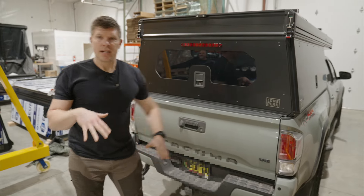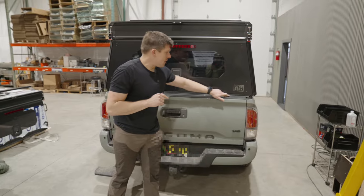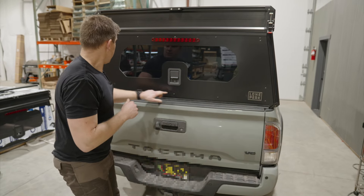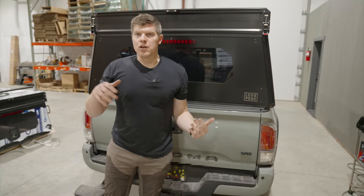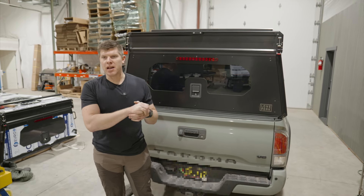Closing up — I like to get this bungee as high as possible. I'm going to grab my strap and use my body weight to pull it down. And then we do something called a double tuck on the sides. This does tuck a little bit better if the windows are all zipped up, but I stick my arms in. Closes up like that. Close your latches. As far as closing your tailgate, it kind of depends on the model. If your tailgate has a lip on it, a lot of times we'll close the tailgate first and then close the camper. Sometimes you have to close them together — kind of figure out what works well for you.